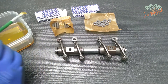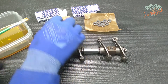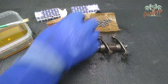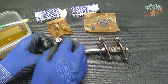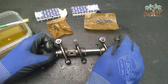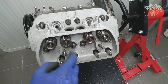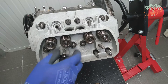Install 4 new adjustment screws with new nuts. Use plenty of engine oil on the threads of the adjustment screws, and screw the adjusting nuts onto the adjusting bolts — they should move smoothly. If they are not smooth, watch the video on rocker arms in the series on engine diagnostics. Before assembling the rocker shaft, check the thread of the stud end on which the rocker shaft attaches. If the stud is damaged, you will need to repair it or replace it.